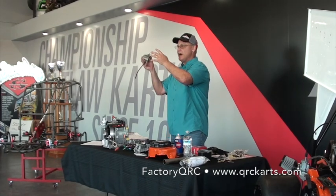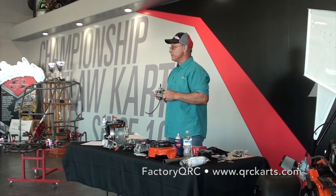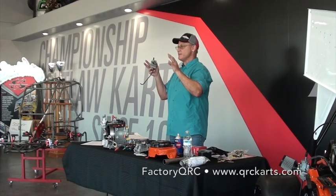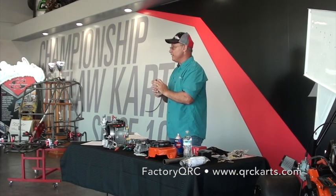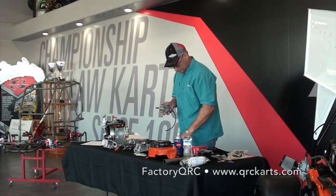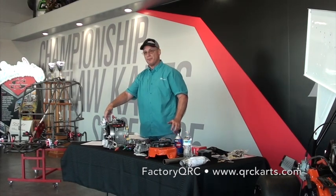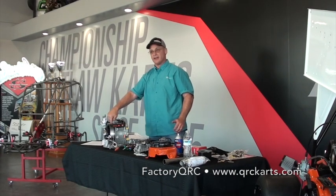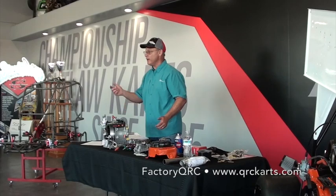Some people want to try to get more air in there, so they'll bring an ether can and spray it, idle it in tech — and if it kills the engine, your day is over; it's a DQ. I'm here today to help you find what those legal gains are, because we don't want any issues on a Saturday night at the end of a race. Keep it stock and it will perform fabulously. As a rule, always put the bolt closest to the recoil shroud in first — start it by hand only, because if you drop it down inside there, you'll have to take the side cover off. Start that one first, then start the other one. You can rotate that carburetor to get everything out of the way, which makes it nice, easy, and simple.